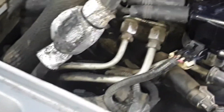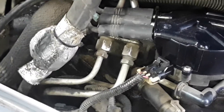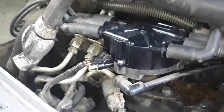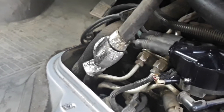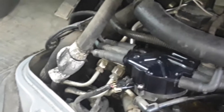I've got another problem with this vehicle. It likes to give me an occasional problem with number 5 cylinder acting up — and it goes into a P0305 code. Only if the engine is warmed up, shut down for at least an hour, and then you try to restart it does it miss on number 5 cylinder, heavy. I've done a cam position sensor, a rotor, the cap was brand new put on less than 3 months ago. I ohmed out the wires, used my DIS tester — each wire is feeding approximately 8,600 volts down to the plugs and they're all conductive. Number 5 cylinder is way down there, the first one on the back bank — really mean to reach. It's a through-the-wheel-well type situation. Anybody got any hints? I'd like to hear it.